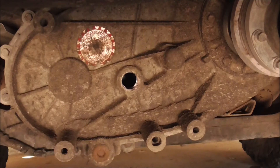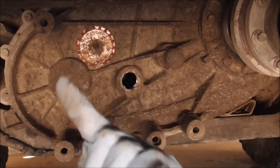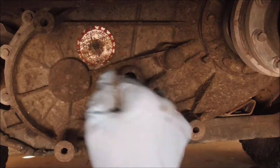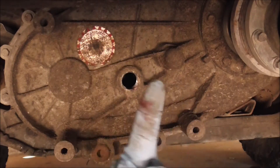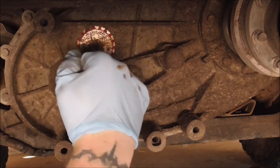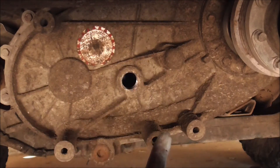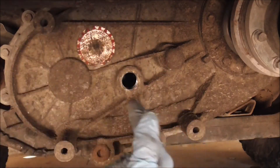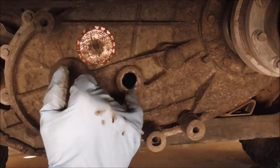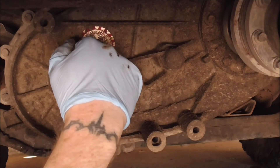Fill plug out — try not to drop it like I did. You want to make sure your glove or fingers are clean. What you're going to do is take your pinky and kind of stick it in there to check the level. You've got fluid, which we do. You don't want to hook your pinky down — obviously if it's touching you're going to be low. Just go in there level like this.